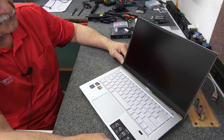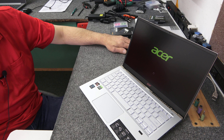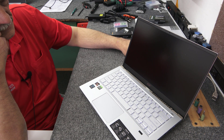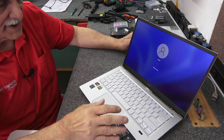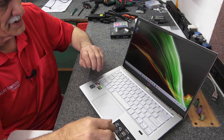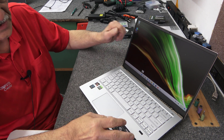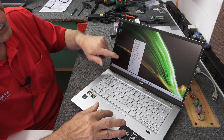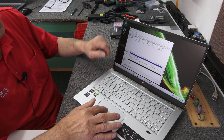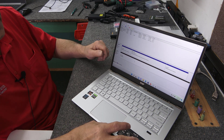This is Windows 11 — it's brand new, there's nothing on it except Windows 11. You could install Windows 11 to a clean install on the new 1TB and leave the 512 as just the extra drive, but in this case he said just put in the 1TB and leave Windows on the 512. So I'm going to go to the Start button, right-click on it, go up to Disk Management. And there's our new drive showing up right there. I'll hit OK — it's showing as Unallocated. I'll right-click on it and hit New Simple Volume.